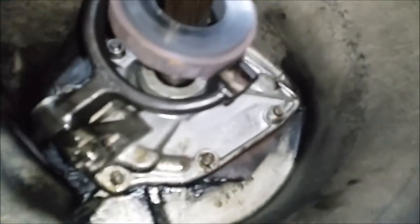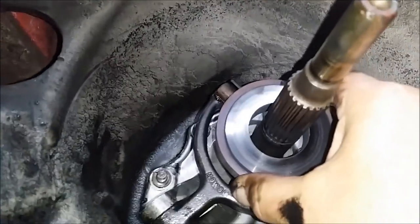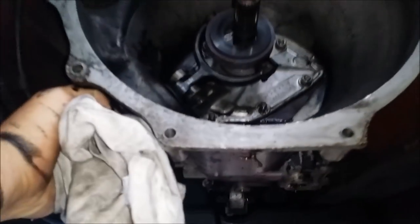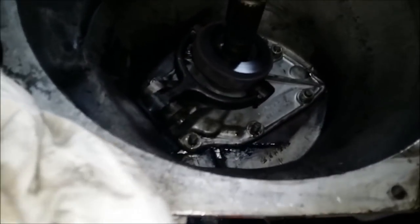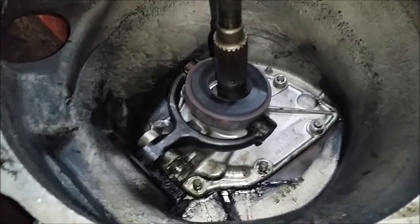Yeah, that's the oil - it's had it. There's meant to be a tube on the front of that shaft, but there's no tube around the shaft. It can't move because it's bolted in, so it doesn't look like it has anything. They had one in there but obviously it wasn't put back in - there's no shrapnel around. It's got a clevis pin. It had a clutch fitted shortly before I bought it, I reckon. There's the split pin - they say you're allowed a drop off that split pin. I'll order another one of those.